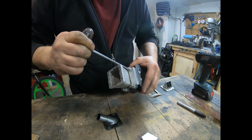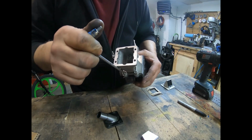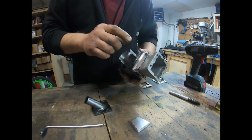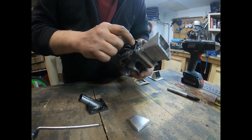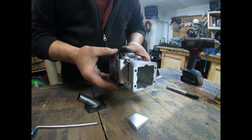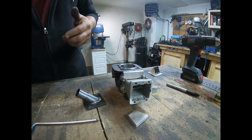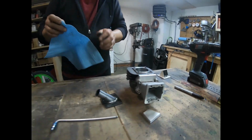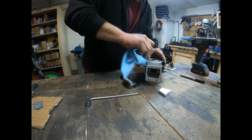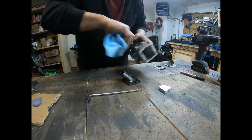Okay, there, there, over there. All right, so that's just snugged in there. The reason I'm doing that is because there's a lot. I don't want to squish out all my gasket maker right off the bat, so I'm going to let that set up now for probably overnight, and then I'll go back and I'll retorque them all down. Like, I can go ahead and wipe down any excess squish out that's there. I'll just clean it all up.